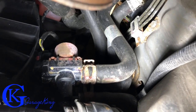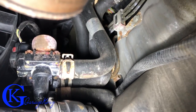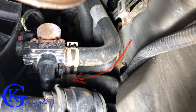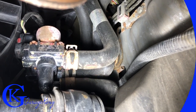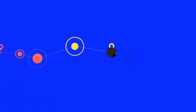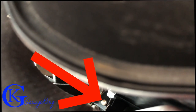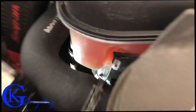Once we disconnect the bolt on top, we should be able to reach the electrical connector, disconnect the two main hoses, and then there's a third hose down there as well. We're gonna find out where that one goes. So now let's go up top and disconnect that bolt. The bolt is right there — I'll throw up an arrow — and through this area right here we should be able to get a long extension down in there.